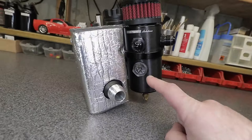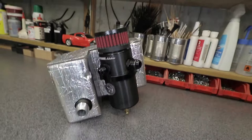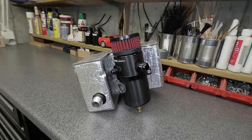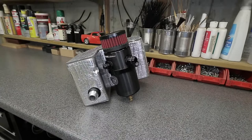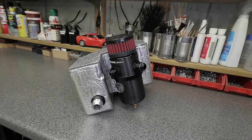There's a sight glass you can see through — some oil in there. The media inside is like a ribbon-type steel, almost like a Brillo pad, and it helps the oil coalesce and settle at the bottom like a baffle. As oil pours in it builds up on the bottom and you drain it. The vacuum pulls the clean air out and back into the intake. I've drained probably five or six ounces out of it — it works, and the result is a bone dry intake and supercharger with no oil residue or carbon.